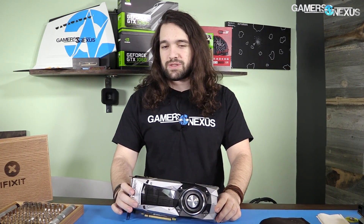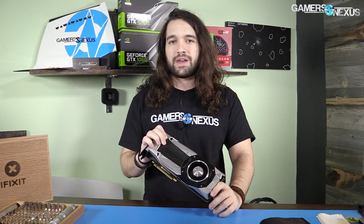Hey everyone, our GTX 1080 Ti review should already be online and now we are tearing it down. This will be part of our progress to building a liquid cooled 1080 Ti as we've done in the past. If you saw our 1080 Ti review, it shows some thermal versus frequency charts where the thing is clearly limited by its temperature headroom. So we're going to fix that problem and this time, unlike before, we'll be measuring VRM temps in the process.